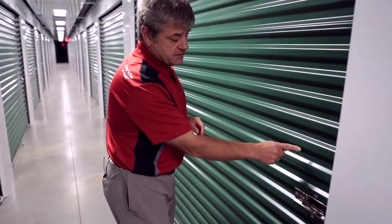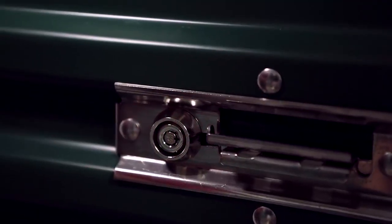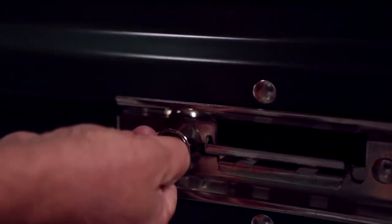What you start with is a hex key like this, and there's going to be a little notch on it. When you look at the cylinder lock in the hole here, you're going to find a notch at 3 o'clock in the center and the outer ring. Push in hard and, while holding in, turn the key from 3 o'clock down to 6. Then pull everything out — the cylinder and key come out and stay together.